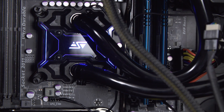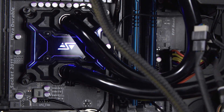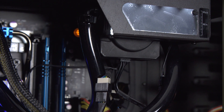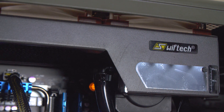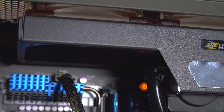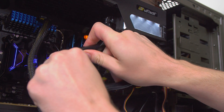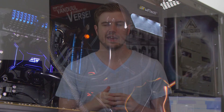In terms of aesthetic, I think it looks nice, but due to the looks and extra features, you may have problems mounting it in certain situations. I wouldn't worry too much about motherboard compatibility, since the hang-off on the radiator will be far away from your motherboard, but I would worry about mounting it anywhere other than the very top of your case. This probably won't matter much since you're likely going to mount it there anyway. The tubing length is also a compatibility consideration — it's not as long as on the original H220, which actually had some pretty ridiculous tubing length. I really do like the thickness and flexibility of the tubing though.